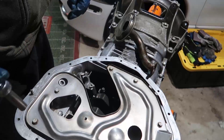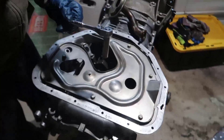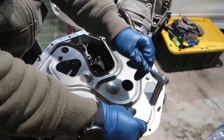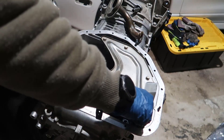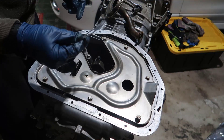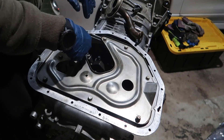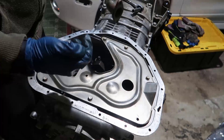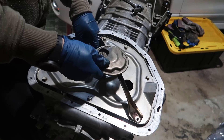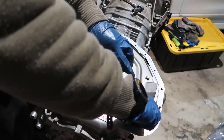Do not over-torque. One thing I did wrong is this bottom bolt here - this is where the oil pickup tube gets tied to. So we're gonna install the oil pickup tube. First thing we do is put a new gasket in there, remove the old one we shouldn't have put in, and put the new gasket back in. There you go, everything should fit as normal.